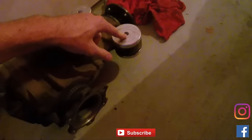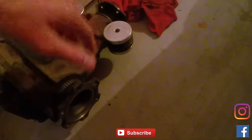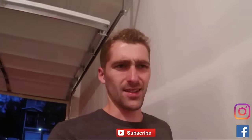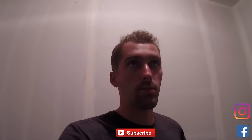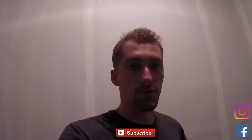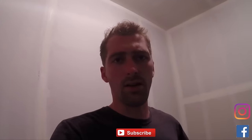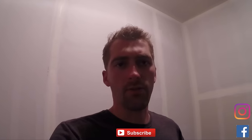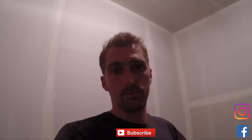I didn't pull these out and put them back into the car because I can't even get these out — there's no way to pry them and press them, they're just stuck. And I wasn't going to buy new ones. The bushings in the new diff are brand new practically. But I still have the solid one in the actual sub-frame, which is the main problem when you go and start drifting — you blow that one out all the time. There's way less chatter with the rear sub-frame and the noise with the welded diff using the stock ears and rubber bushings rather than the solid ones. Quick tip.